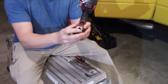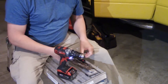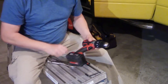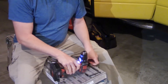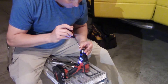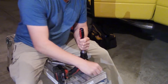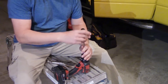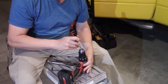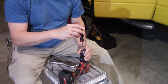Anyways, let's get to it. There is a screw down in there. I've seen some videos where people show you how to take this off, and I'd like to say I really don't like knocking other people because they took the time to make the video. But they do a couple of things like putting the drill in a vise and putting a big Allen wrench in there and smacking it with a hammer. I'm going to show you what I consider the preferred method. So we are in first gear — you need to be in the lower gear. I've got a larger straight screwdriver in here, or this Milwaukee M18 could also use a Phillips 3.